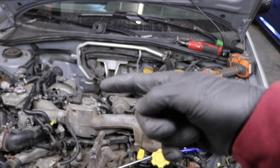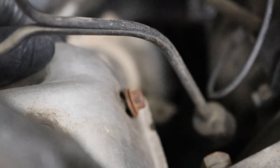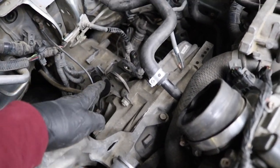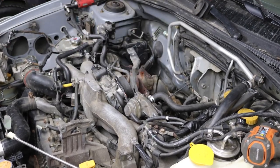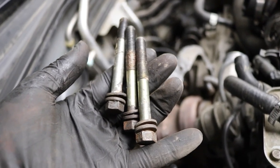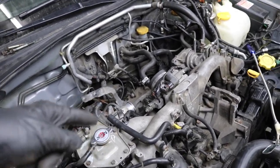Next I'm getting the turbo heat shield pulled off, then we can start unbolting the downpipe and get the top bell housing bolts pulled out. My heat shield is missing about 90% of its bolts and the ones on there are just loose — it was rattling around everywhere. Then go around where the transmission bolts to the engine and find all the bell housing bolts — they should all be 14 mils. I got three from up top: one right next to the turbo, one just under the turbo, and one lower where the starter was. The only two left are the stud nuts on the bottom.